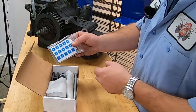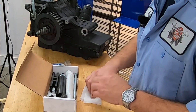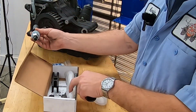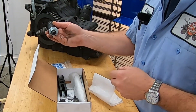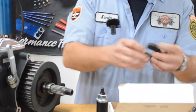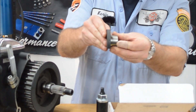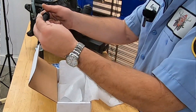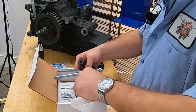One of the first things you get is a set of thermal stickers — very important during the disassembly process, so keep those in a safe place. There's the installer tool; this piece here would thread onto the end of the main shaft, and then you use this sleeve to install it — but we'll get to that in episode two when we rebuild this transmission. You also get this small collar, which slips behind the bearing race, plus this bar, this threaded tool, and two long bolts and washers.